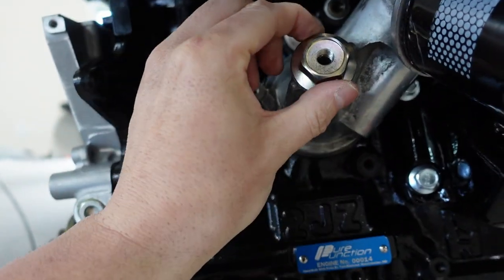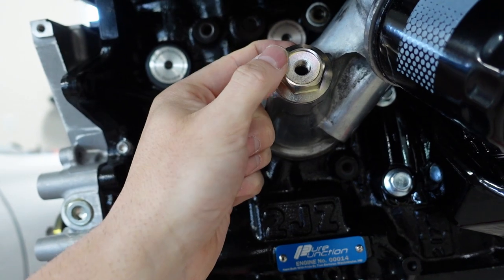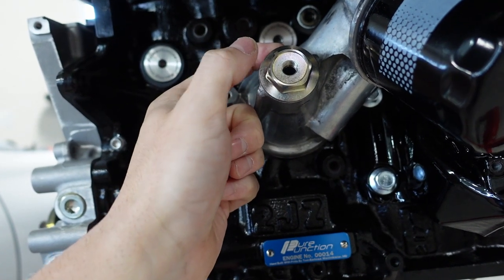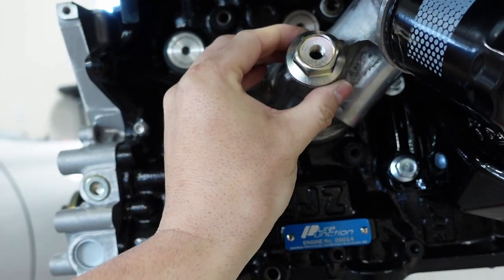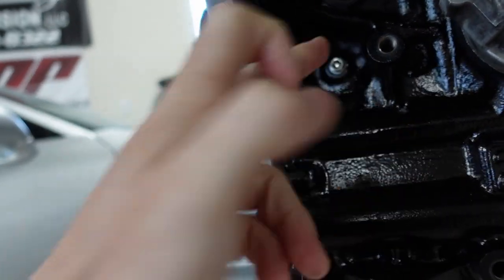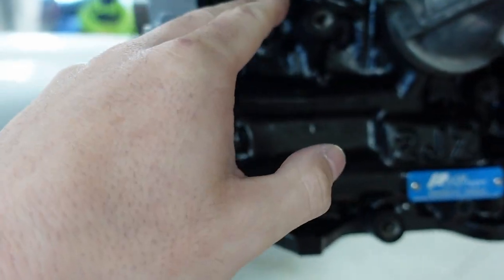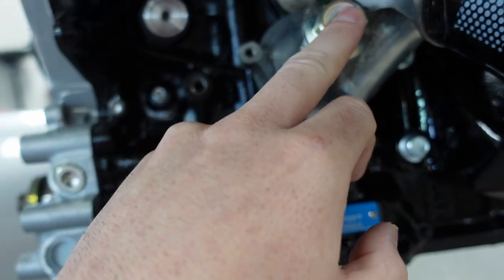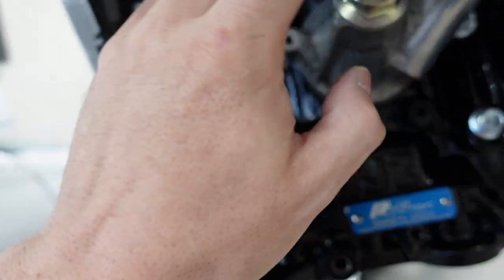I don't even know the exact foot-pounds — I just crank it down because I don't want it coming loose. I need to get a sensor but I don't have the adapter yet. I originally was going to drill one of these out and tap it — I think it's M10 by 1.0 for the Bosch sensor — but the metal is so hard it's unreal. So I'm going to have to use an adapter with the Bosch sensor, just like I did on my wife's. Not ideal, but it should work. There are two ports but once the AC is bolted up it's near impossible to get to one of them, so I'd rather plug those off and get to something I can easily access.